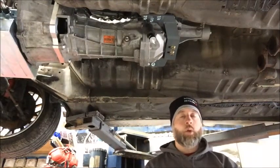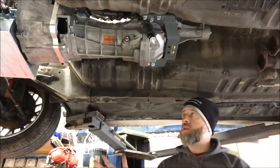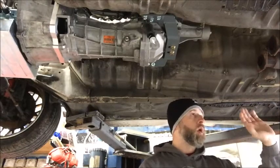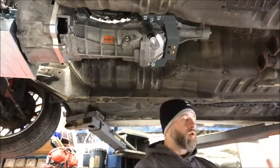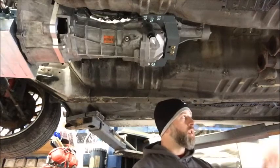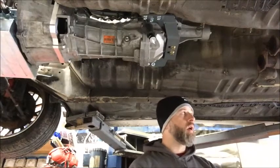So what we're going to do is fabricate our own full exhaust system for this car. It'll be a full 3-inch exhaust. We're going to install an X-pipe right about here. It will have catalytic converters, and it will have four mufflers. The first mufflers are going to be a bullet-style resonator to kind of take some of the rasp out of the exhaust. And then at the back end, we're going to install standard canister-style mufflers, probably all Magnaflow.